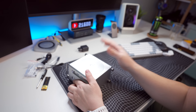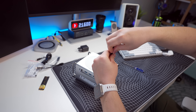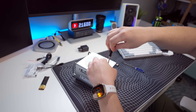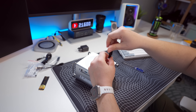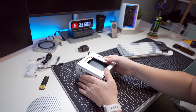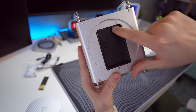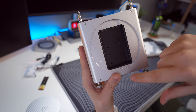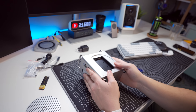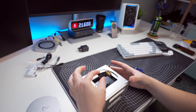The next thing to do is unscrew this section and place the NVMe SSD inside — I'll show you how. Using the other screwdriver, there's one screw; once you take it out, it unveils the two NVMe SSD slots. You can use different sizes of NVMe SSDs — that's what the different holes are for. If you don't have the standard 2280 size, you can use the smaller ones and attach them accordingly. Something to note is NVMe drives with a heat sink — you need to consider how thick it makes the drive.